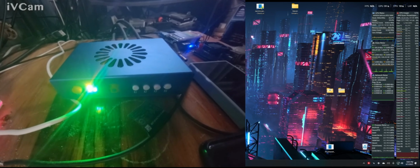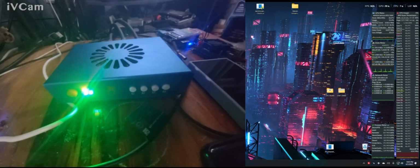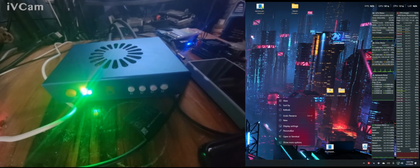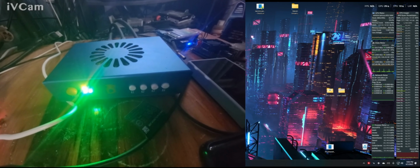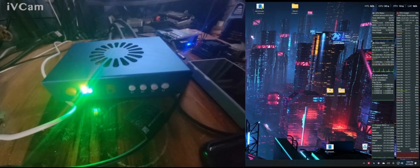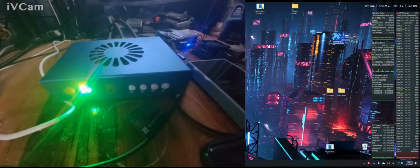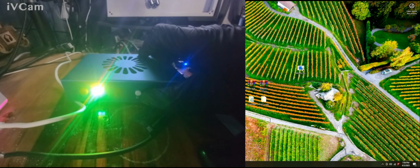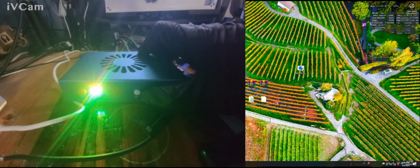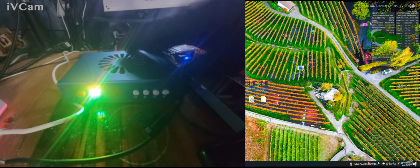In other words, only you will be able to see the second PC overlay. As it happens after the video signal leaves your PC, for a lot of people this can be jarring and take a minute to understand, and you might try to click on things on your second PC from your main. I have a capture card connected to my fuser so I can show you how it looks. Other people, such as myself, when you screen share or if we remote into your computer, cannot see what you see, as the fuser is displaying your main computer and then putting your second computer over it and removing anything black. It is a standalone unit and does not need any software to work.